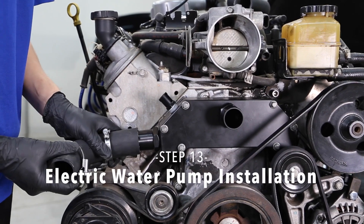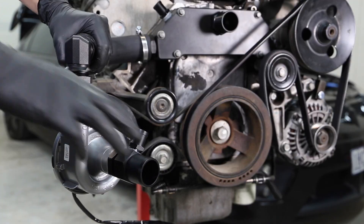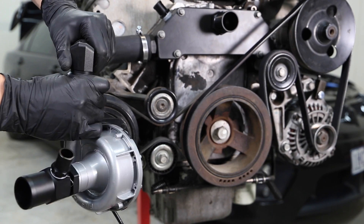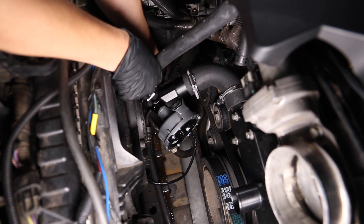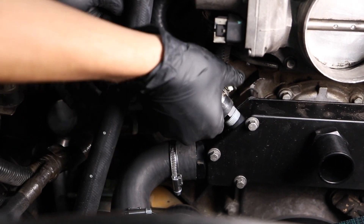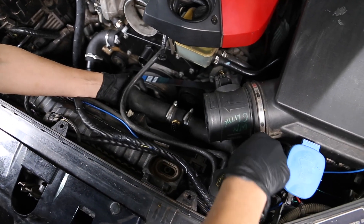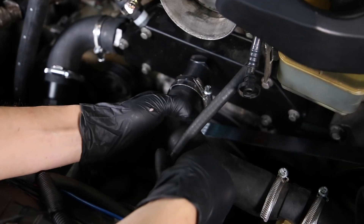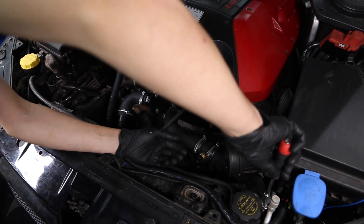Step 13. Install the electric water pump to the LS engine. Place the 90-degree elbow hose over the EWP adapter inlet along with the two hose clamps. Once the pump is in place, locate the heater return hose and connect it to the return adapter on the inlet of the water pump. Take the remaining heater hose and push it onto the 3/4-inch fitting on the adapter block. Place the other end onto the bottom radiator outlet. Insert the thermal sensor and adapter for your EWP combo kit into the top radiator hose and reinstall. Tighten all hose clamps.